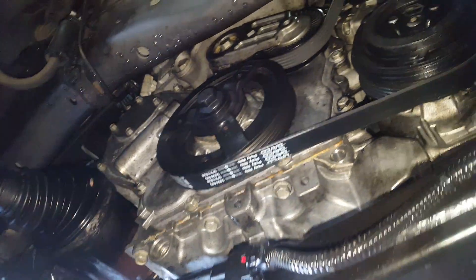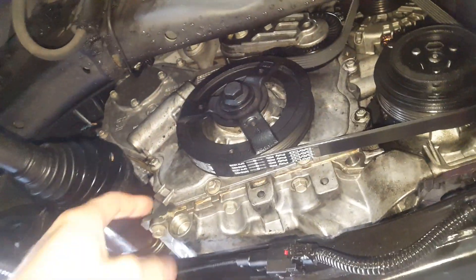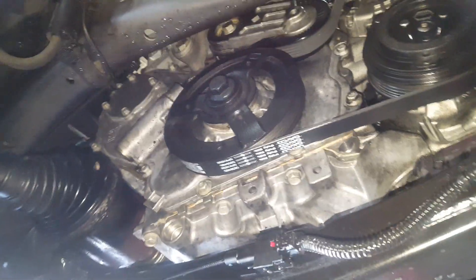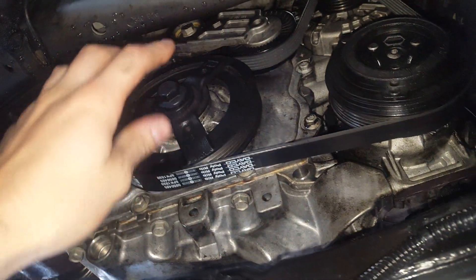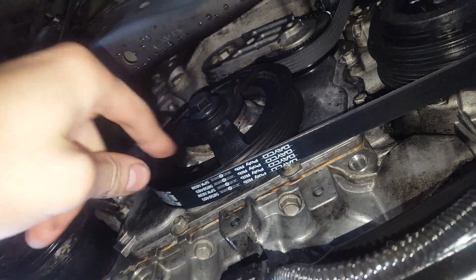As a result, the chain to the water pump is now too tight. The good news is you can easily fix this, and all it'll cost you is the timing cover gasket — you'll have to buy one of those. In order to get to it, you've got to remove basically everything in front of this cover.